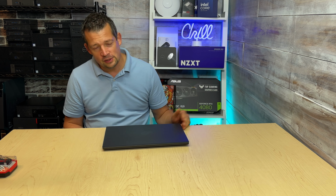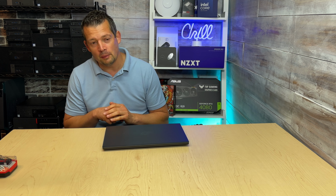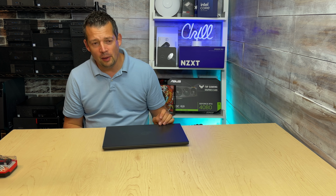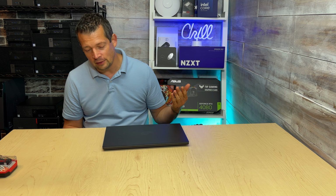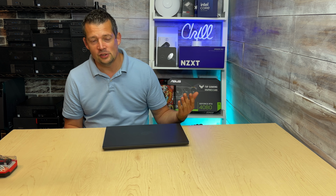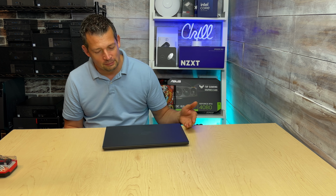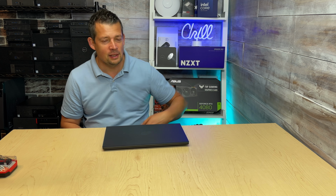And normally it does. We shut everything down. We're gonna connect the original battery back on, and we're gonna hit the power button and see if it comes on. In most of the cases it comes on. There are some cases it will not, where either the laptop has physical damage, maybe some liquid damage, or maybe the motherboard just failed, or a BIOS failed in a Windows update process, because Windows can update our BIOS now on laptops and desktops. That is also a possibility.